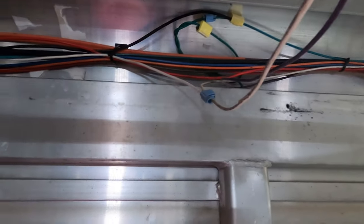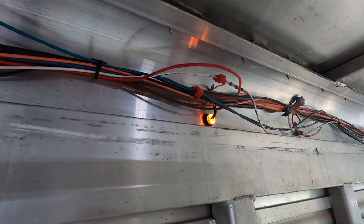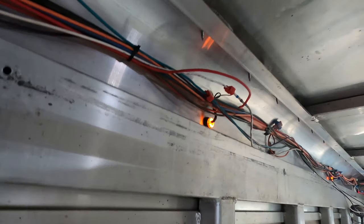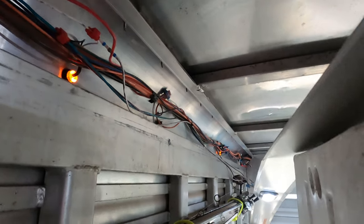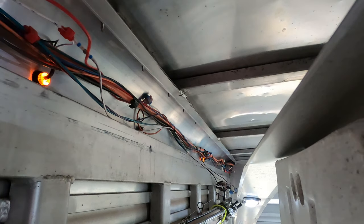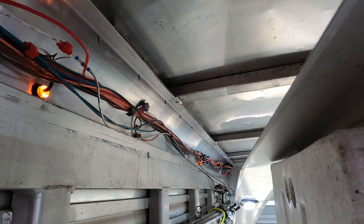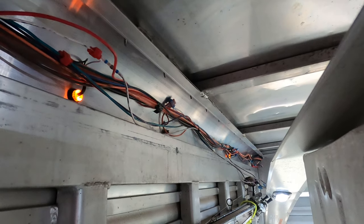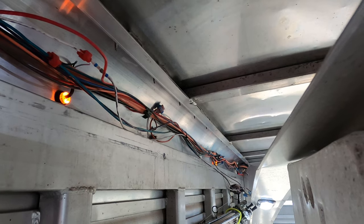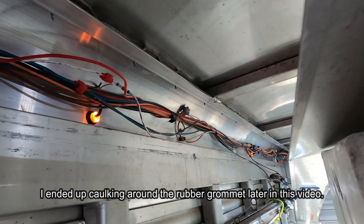It's very important not to oversize your drill hole for the light. If you do, water will get in. You need to be very cautious and careful with the rubber grommet - make sure not to oversize your drill hole. I oversized one and it rained last night and water got in. I'm going to start making my drill holes a lot smaller - that was the only one that did it, I kind of beveled and over-drilled it a little bit.